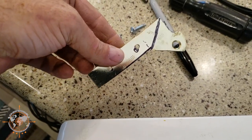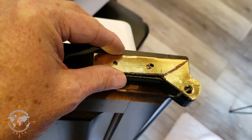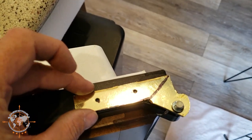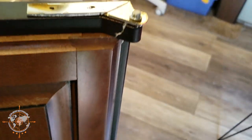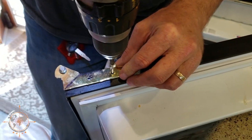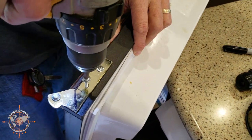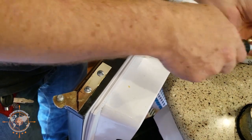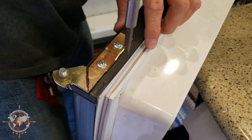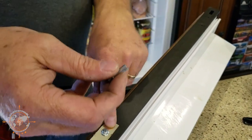Okay so here's what I came up with, just using a little hand saw that I have. I drilled a couple holes so this is going to go on like this. Here's the pin that goes in the door — it'll ride on the pin just like that and then I'm just going to put two screws in it. It might not be the prettiest thing but it sure beats buying a new door. I'll tighten these up by hand without stripping them. I'm going to put this back on the bottom where it goes — it actually threads in — and then I'll set the door back in there and we'll see how it works.